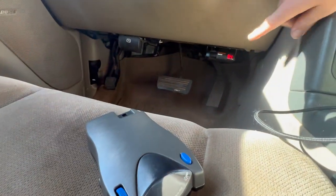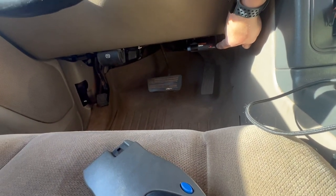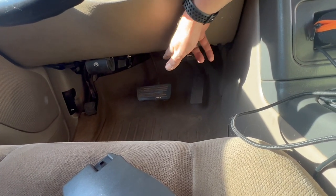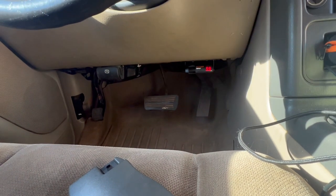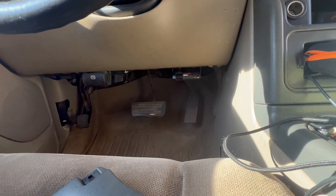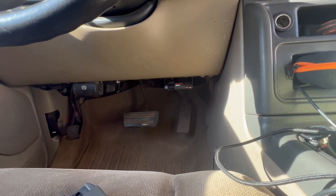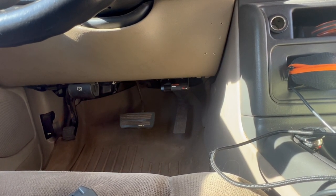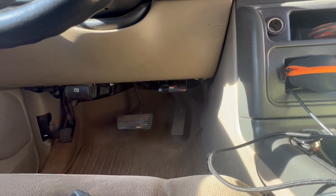Right now, most of the time my braking on the Curt is only around 3, but I'm having to max out the brake controller to 9.9. I know there might be other issues associated with that, which we'll dive into in another video. Most of the time I'm only getting about 3 out of 10 power, which is only 30% braking — and that's not doing me any good.